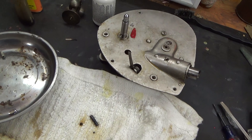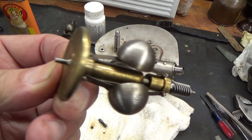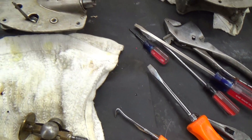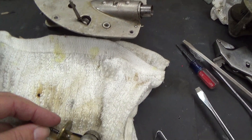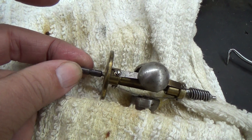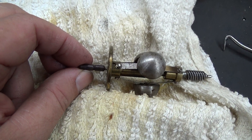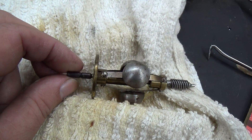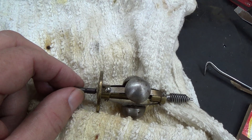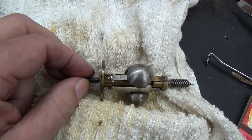You have to get them out of there and apply fresh oil so they're doing their job. They go on either end of the governor shaft. You also have to check that when they go on a shaft they fit snug — not sloppy and flapping around. Sometimes they'll get that way from lack of lubrication, which is not good. It's going to cause noise and possibly stop the motor if it gets bad enough, because it's not properly aligned.